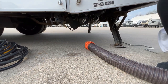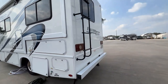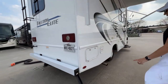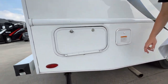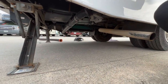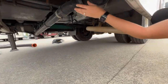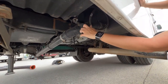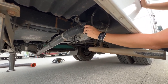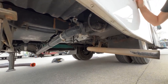We'll show you where the second handle is — it's located in the rear of the RV. It's really hard to see; you kind of have to go underneath in the far back of the coach. So if you happen to forget, your second stage handle is right back here. This is the second handle, and if you don't open this handle, nothing's going to come out of the black tank. So this handle is very sneaky, hard to find, but this is where it's at.